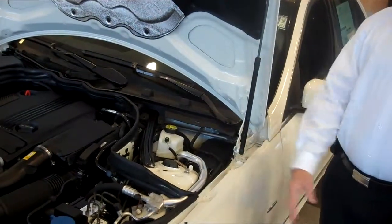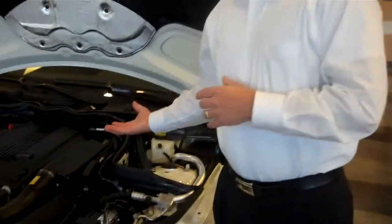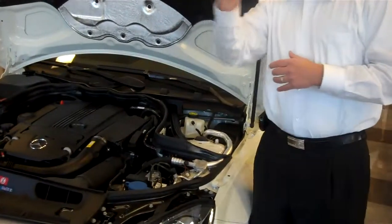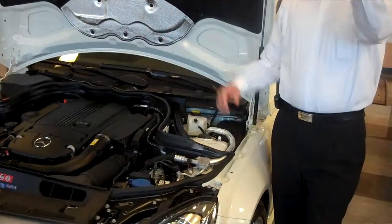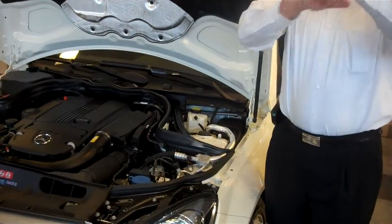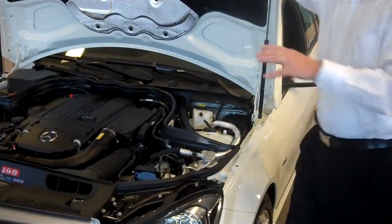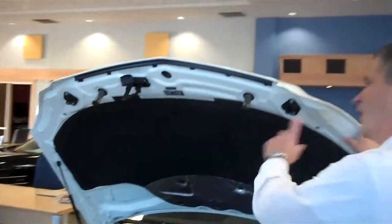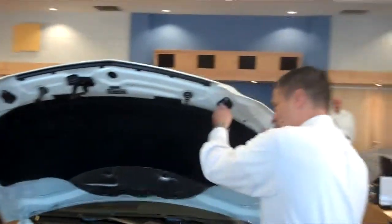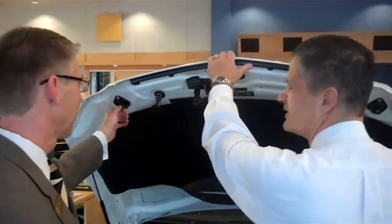Where are your feet? Your feet are here, the dashboard's back here, and you've got airbags. You have knee airbags in this car. But another thing this bar does — it actually makes the car crumple in a different direction, giving you more room as the car takes the impact near your feet, which is closer to the engine. That way you don't break your ankles, your legs, and everything else. Also, three solid hood latches — they don't want that hood coming up. Other manufacturers have them, but go check — you'll find out they're plastic, not steel.